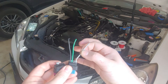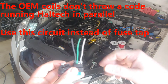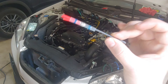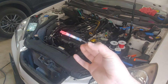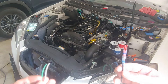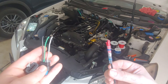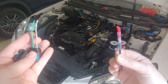And this 12 volt - what I am doing is I actually just use a fuse tap essentially on the exact same fuse that the stock ignition coils use, and I've just run a 12 volt around. I only had black wire, so unfortunately I'm using black wire for that. And what I will end up doing is something like this, where essentially all four wires come into one. This will be like the main power because they don't need much amperage. I'll put it all together, and if I include this clip, you'll know that I connected them the right way because the car will be just fine.